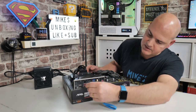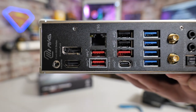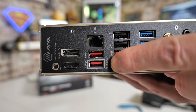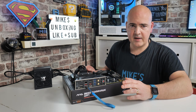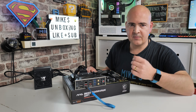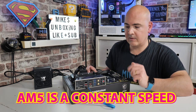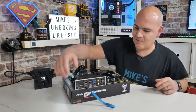Now we're pretty much ready. Turn on the power supply. Now for the USB stick — plug this into the USB flashback port, which is highlighted with a rectangle around the outside of it. At the very end you'll see the BIOS flashback button. It says in the manual to just press the button, but I like to press and hold it for a count of three seconds just to make sure it's registered, then release and wait to see what happens. What we're looking for is the LED to start flashing. This is my first time flashing an AM5 board, so fingers crossed.